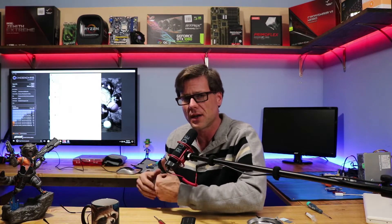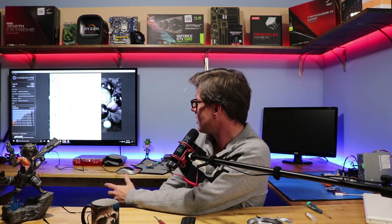Now that I got the Cinebench out of the way, I'm going to do some streaming, do some web surfing, see if it performs any better. Before, every now and then it would kind of hiccup a little bit — not bad, but a little bit. Maybe now, since this thing is not hitting thermal throttling, it might run better. Before, when I was just surfing the web and streaming videos, it was constantly running at upper 70s to lower 80s temperature. Now it's running cool — already down to 58°C on the hottest core.